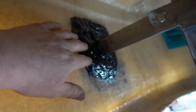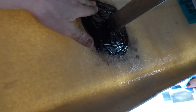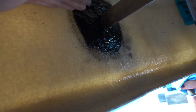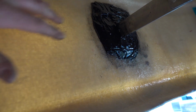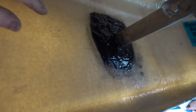So last night, I re-epoxied our hinge pieces to our fiberglass front clip. I did go a little wider with our epoxy. Also, I cleaned all the old epoxy off and redid what we did the night before. Like I said, when I first tilted the hood, it was fine. But when I overextended it, I could hear the fiberglass stretching. So we're going to take the front clip off, flip it on its back, and talk about what we're going to do. So, wish me luck.